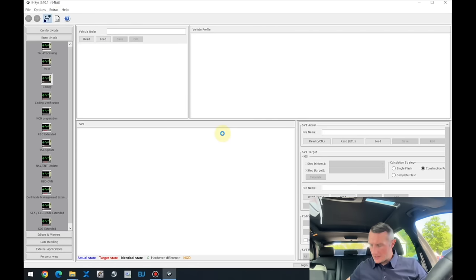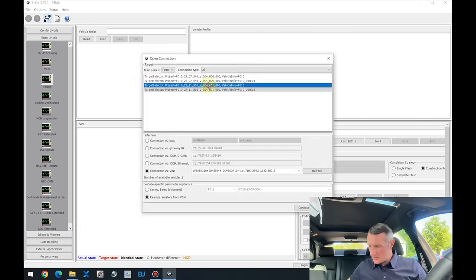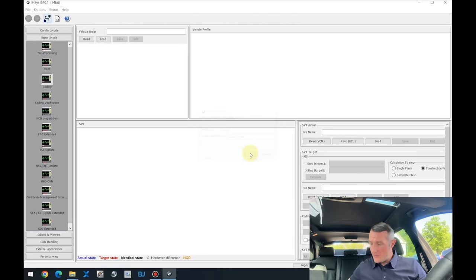But remember, in the Esys, we are still able to see that SCR ECU. So, as the final thing, let's run the Esys again and let's check if we can see it or not. So, let's quickly connect via the Esys. F10, connect, yes. And the good result will be if we are reading out the ECUs, and actually we will not see 39, but we should see 38 ECUs.